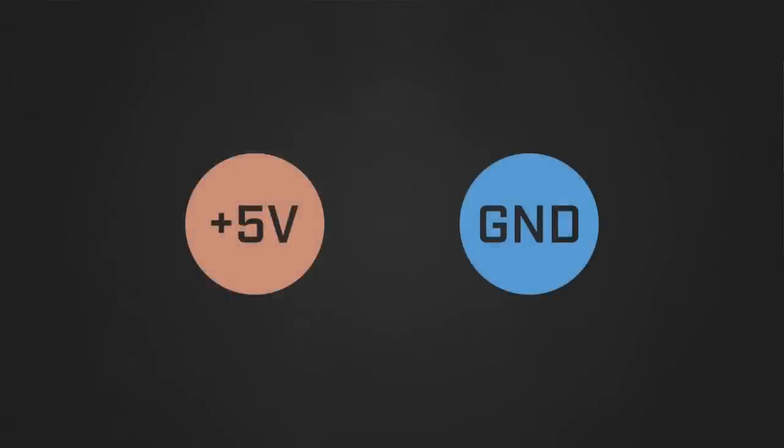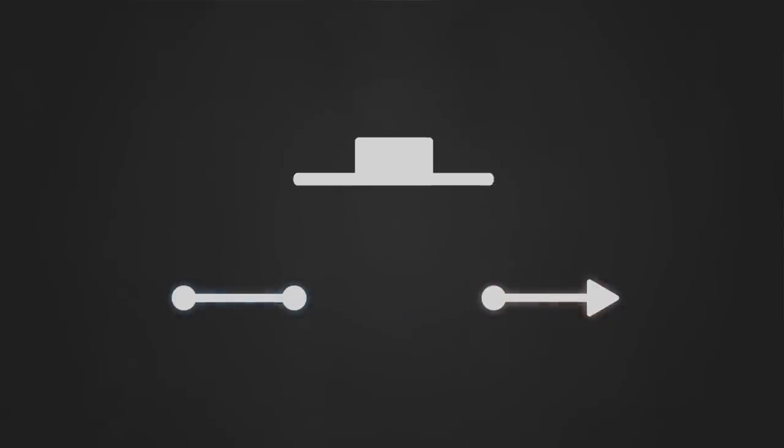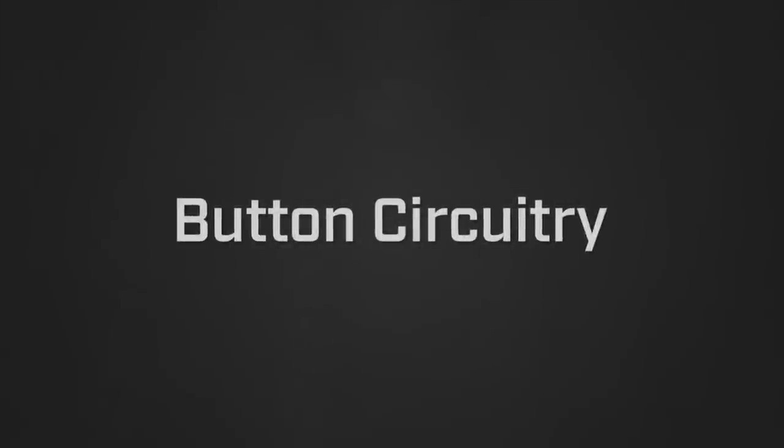The end result is that you can convert a messy real-world signal like voltage into a crisp and clean digital signal with a fair amount of reliability — pretty important if you want to build something super precise like a computer. With this in mind, you can probably already guess how the controller ends up sending the data for buttons. It provides a high or low voltage representing a 1 or a 0, which is then interpreted by a game as a button either being pressed or not pressed. On the controller's circuit board, each of the buttons is represented by a switch. If the switch is on, then the 4021 chip will read one value, and if it's off, it'll read another. You might expect it to read a 1 when the switch is on and a 0 when it's off, but hilariously, it's the exact opposite.